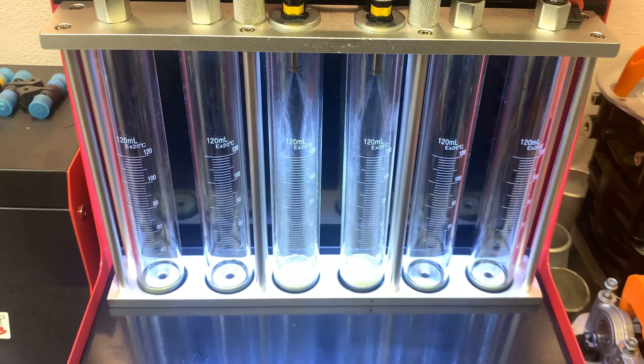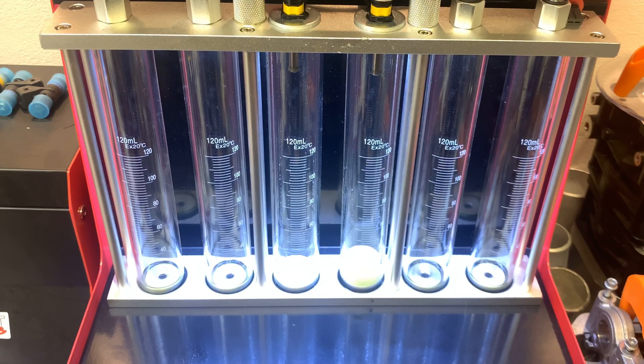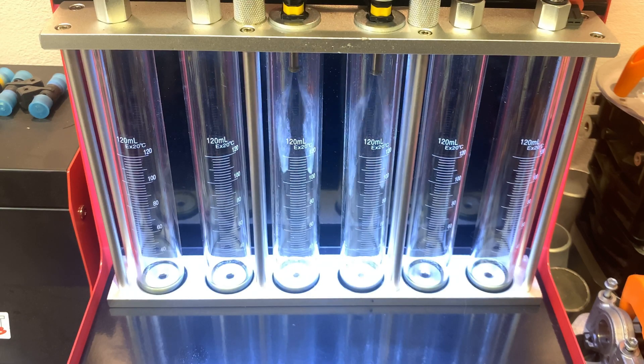Look how the spray pattern is looking at the different speeds — on medium speed, on high speed — it all looks good. That's all okay, also when the RPM is going down again. Yeah, that all looks good. We drain it and then check the fuel levels — we check on medium speed. Let's see that it is really empty, and then we check. They are never completely equal, but let's see.